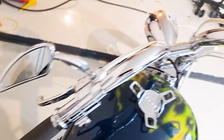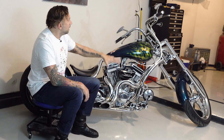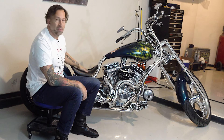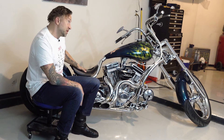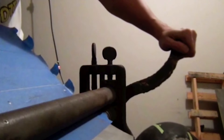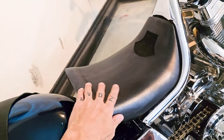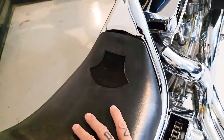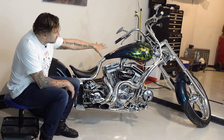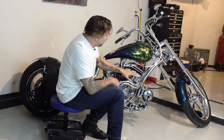I went with very clean and simple PM hand controls and foot controls — no blinkers or speedometer. The horn doesn't have one, but I have to put one on once a year just to pass state inspection. I made the seat pan by basically rolling some metal and welding some mounts to it, then Concepts in Jacksonville made the seat, complete with a cool little suede axe insert. The tank came from Fat Cats, and both fenders were from War Eagle, and I did the metal work to make them match.